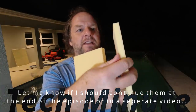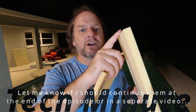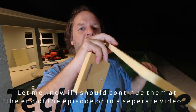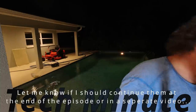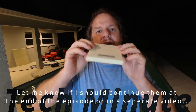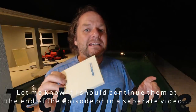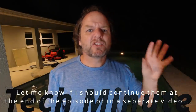The name brand on this SAN foam is Core Cell. The reason I'm using this is because when they built the Antares boats, Core Cell is what they use. Here again, it's extremely strong and stiff material. The next one is PET foam. The advantage of this foam is it doesn't have quite the same material strength — although it's still pretty strong — but it's a lot less expensive. The problem with SAN foam and PVC foam is they are extremely expensive; for three-quarter inch, four-by-eight sheet, I paid like $300.